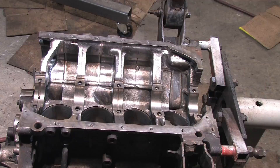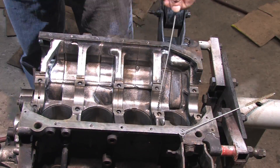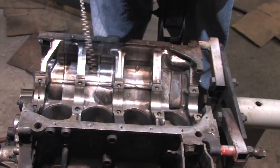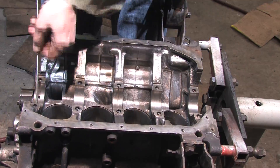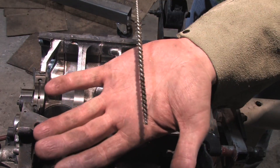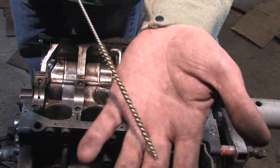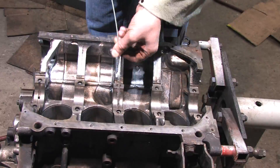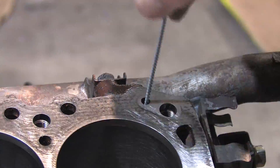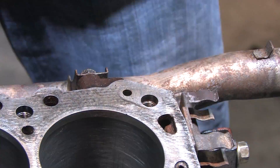The last thing I want to do before the final cleanup is wire brush out all the oil passages in the main oil gallery. This is something you should do whether you did the preparation for assembly or not — a detail that lots of people overlook. Any trash in the galleries will affect your brand new bearings. Harbor Freight sells a big box of tubing brushes in brass or steel for under $7 — everything you need to clean up every passageway. The looped end on the handle comes in handy when pulling them out; you can stick a screwdriver or ratchet extension through it. Don't ever break one off inside the block — it would be a nightmare to remove.